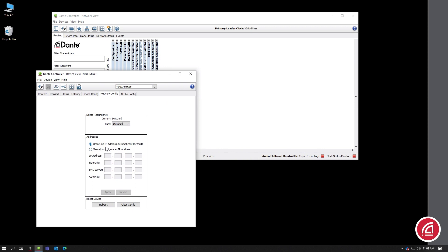Here, you'll find options for automatic IP like DHCP, or static configuration. If you want to set a static IP, just click the radio button and enter your settings. Click Apply for the settings to transfer to the device. You'll likely need to reboot the device for the settings to take effect. Some devices can use the Soft Reboot button here in this menu, while others may require physically cycling the power.